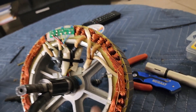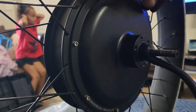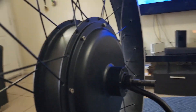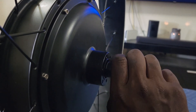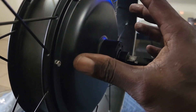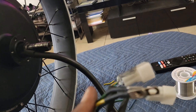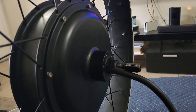I'm going to go ahead and zip tie this up just to be safe, then we're putting the stator back in the hub. I got the cover back on, screws tight, and put a little bit of silicone around the edges of the cover. When you put it in, you want to start from side to side — top to bottom, left to right — not in a complete circle, so the cover can seat on the bearing properly. Once it's seated, turn it and feel for any noise or resistance to make sure the stator isn't binding against the cover. Everything is looking good. We'll test the phase wires to make sure they're working.